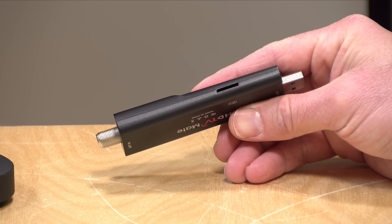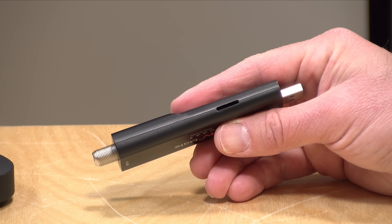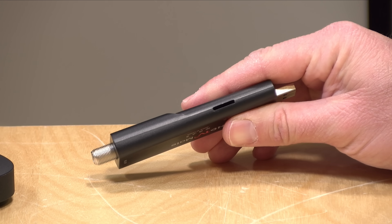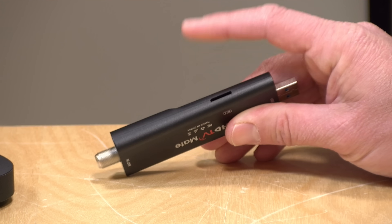There's also an SD card slot you can use to record whatever the tuner is receiving live. It doesn't have any scheduling capabilities, and this is only a single tuner device, but if you're watching the news and want to record it, you can hit the button midstream and record onto the card to watch later. However, I was not able to get this feature to work on either my Google TV device or my Android phone. Every time I hit the DVR button on the TV, it said my app doesn't support that, and on the phone when I tapped DVR, nothing happened. I suspect they have to work in some permission requests to allow access to the file system, because the SD card slot — even though it's built into the tuner — shows up as a separate device on your phone, basically an SD card reader. The Antenna Man did get it working in his review on the unit they sent him, so I think it might just be an issue with some of the newer versions of Android.